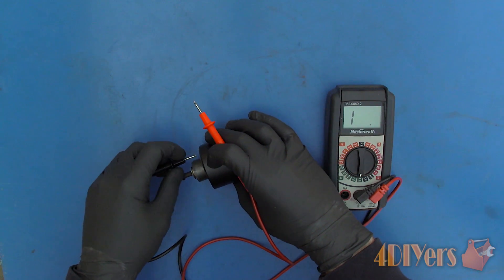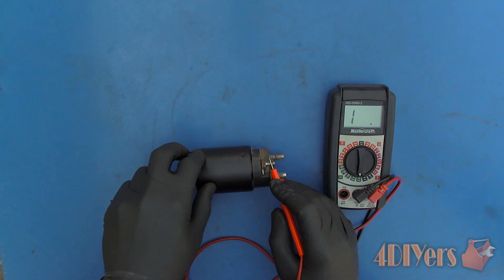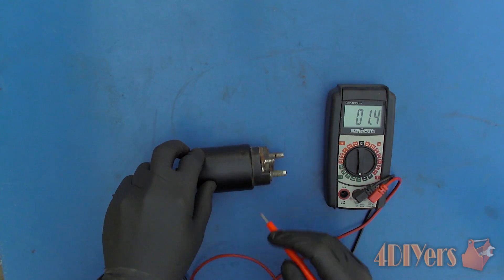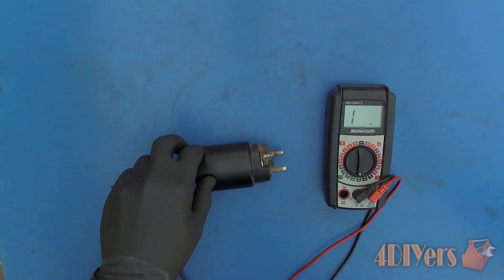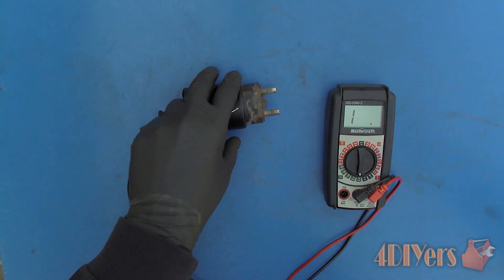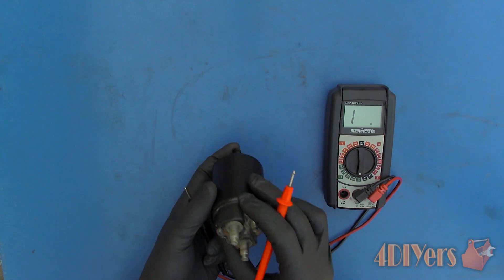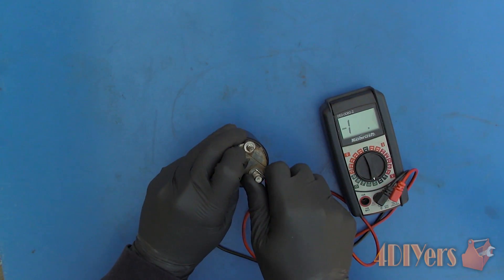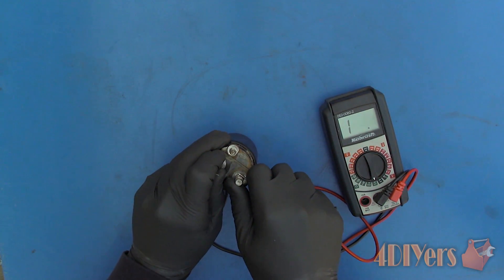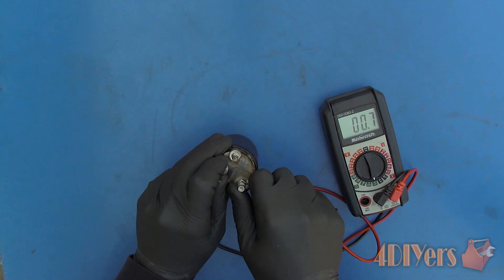Finally, we can test the starter assembly, which is normally easier when it's removed from the vehicle. Set the multimeter on the lowest ohm setting and test the resistance of the coil — values will vary between solenoid designs, and if it's outside that range, the coil is failing or faulty. The case is ground and the small terminal is the power for the coil. The solenoid also has an internal connection to switch the high amperage circuit. Do not hold the power on for an excessive amount of time as this can overheat and burn out the coil. If it has a plunger, push it in manually and test for continuity. If no continuity is present, the terminal inside has failed. If all tests pass, then you will have a faulty starter motor, and individual tests can be done on the motor with a tutorial included in the description below.